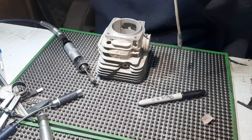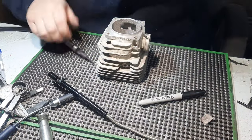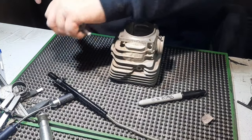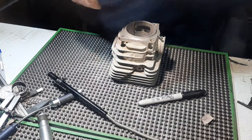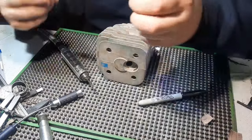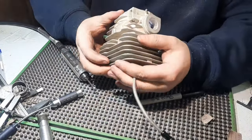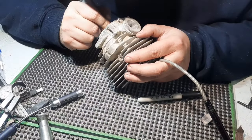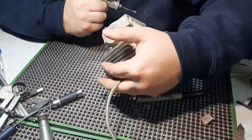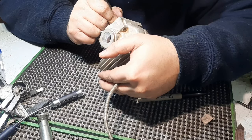I just leave the transfers and the other ports as finished with the burr. We'll go in with our diamond ball and we'll bevel everything up good. Now this bevel or chamfer - whichever you want to call it - is just to break the edge.